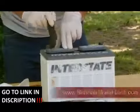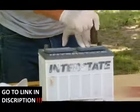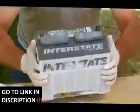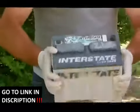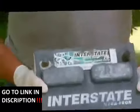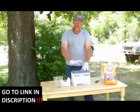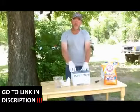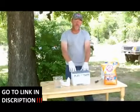Put back on your caps and secure them well. Then shake your battery so that everything is well coated inside. Now you want to put this on a 12-volt, 2-amp trickle charger — the lower the amps the better,